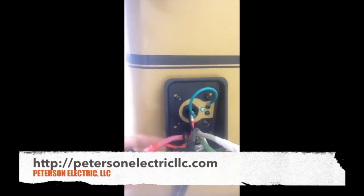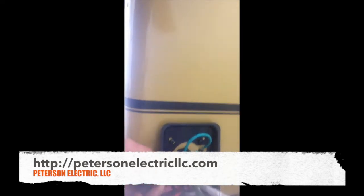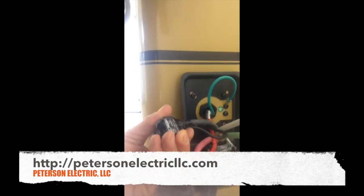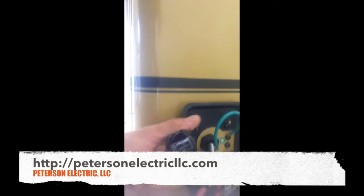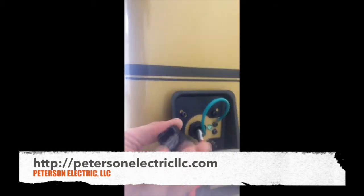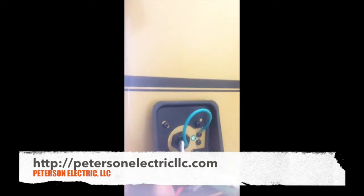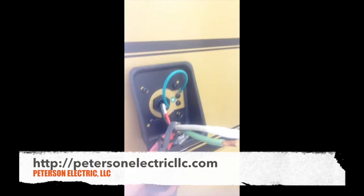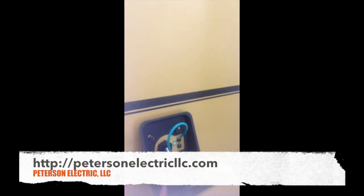I have my red to their red. The red is like a ten-gauge, but it doesn't matter — I still need to protect my side because that's what I have to put in versus what they're putting in, and that's manufacturer spec. These are Polaris rubber insulated lugs; there are two ports inside this little connection right here and they actually have a set screw.